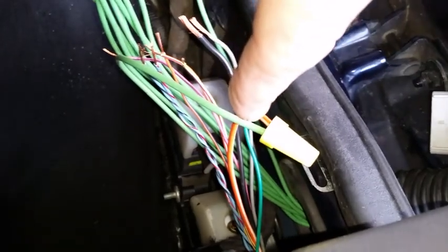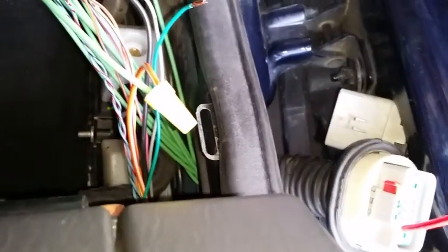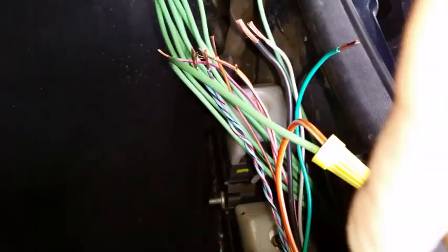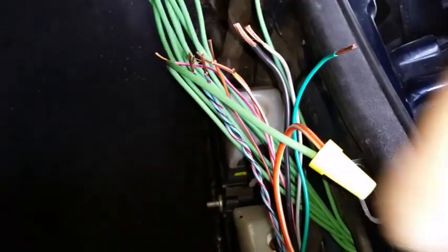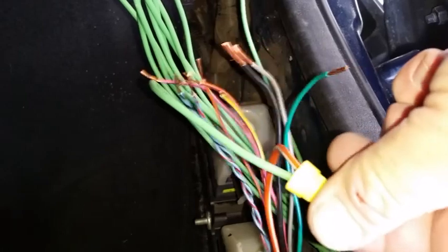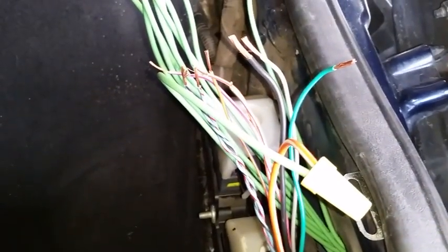Then two small tie wraps. I used that huge one earlier to keep the wires together when pushing it through that boot. Two small ties, one around the tape at the bottom, one up at the top, so that those wires and the wire nut are not going to have any relative movement for the life of the vehicle, basically, that's to be hoped. So tighten it pretty good. So the wire nut's on there good. And then I'll show you what it looks like after that next step's done.